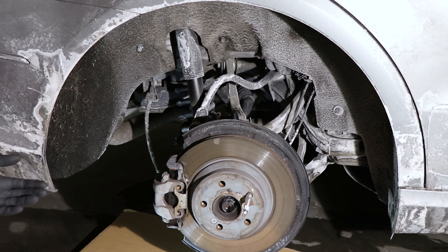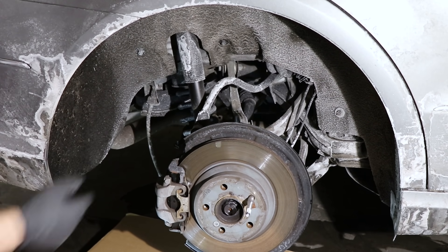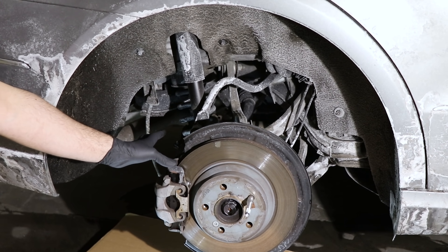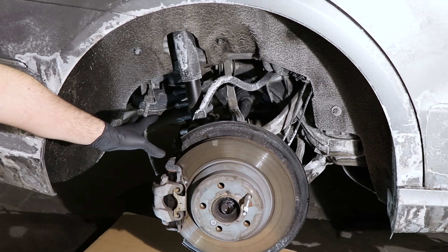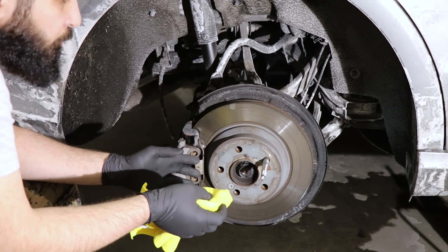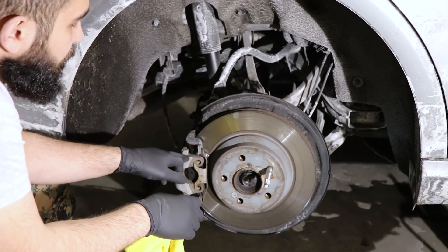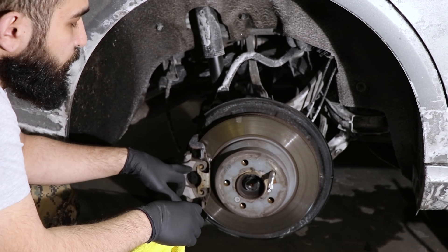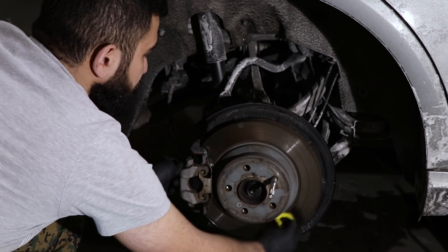For the other wheels, you're going to need just a few pumps — maybe five to six — because the line is not too long. This rear passenger wheel needs the most pumping because it's furthest from the reservoir. Now the hose is all brand new fluid, so this wheel is all set. After all that was done, if you have brake cleaner you can spray this area to clean the caliper, but avoid spraying any areas where you just put anti-seize or lubricant because you'll wash it right off.